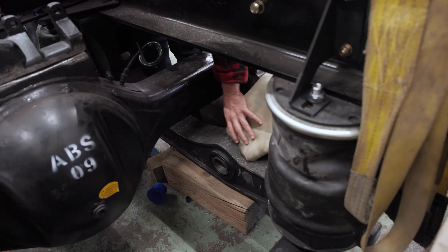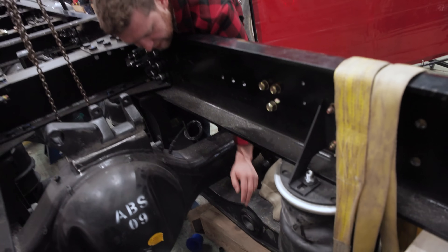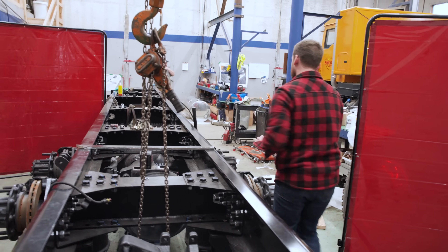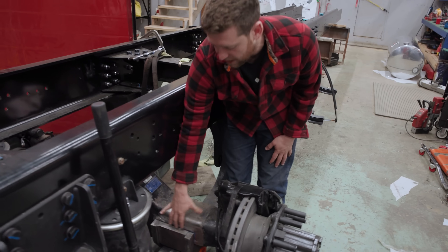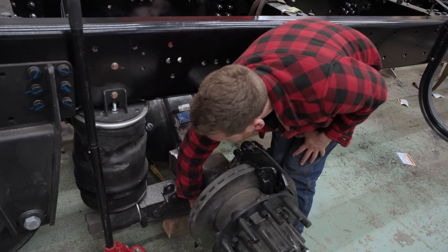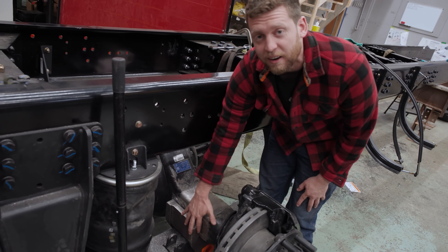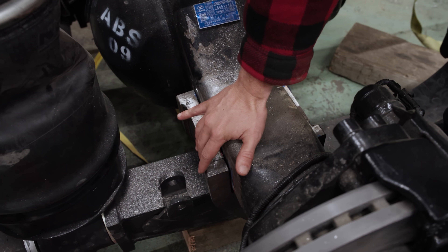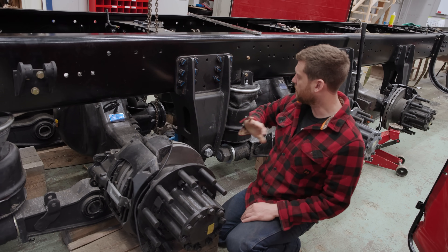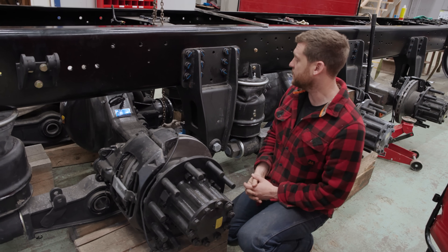The hangers attach right here — there's basically a cradle that holds this axle that gets welded on, and then the hanger gets a bolt through it. This one here already has the hanger waiting to be welded on — it's basically a big steel piece, pin goes through here, and this gets welded on there. We have made very, very Skookum axle mounts. That is not going to break. I really like the AAD suspension — this is one of the toughest suspensions on the highway.